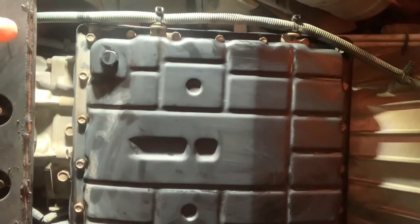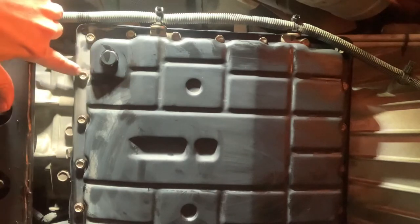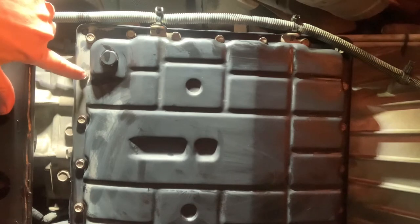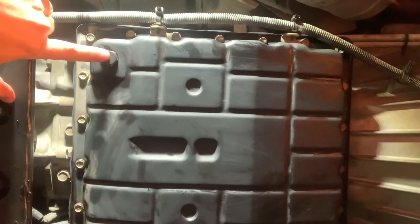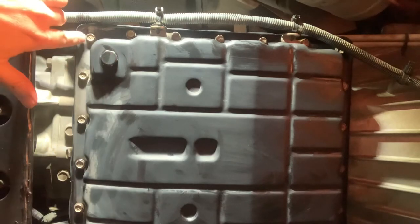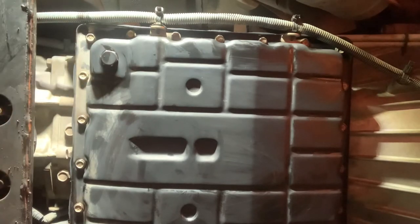The pan is cleaned and now we're going to service it. Remember: the 10mm bolts are torqued to 70 inch-pounds, and the drain plug is torqued to 25 foot-pounds. There's a big difference between foot-pounds and inch-pounds, so don't confuse those — you'll strip these out very, very quickly.